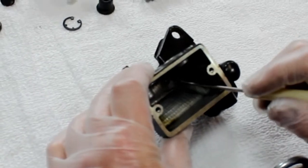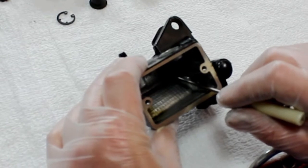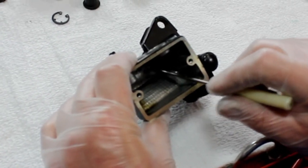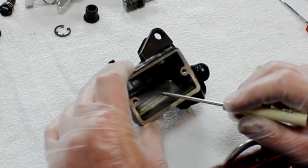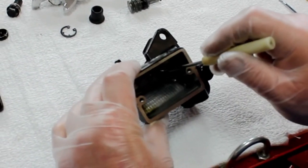This is very important. This hole is very large and takes a lot of effort to block it. This one is quite small and blocks easily if the fluid is corroded, so we need to make sure that's clear. You can use a guitar string — an E string — a numbered drill bit, or a very tiny pick, but it will be important to ensure that that's clear.